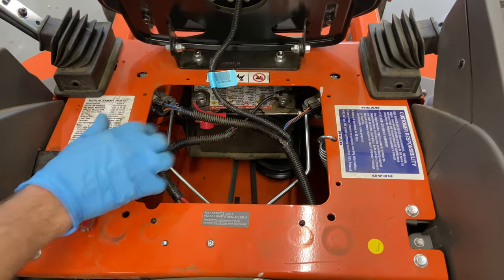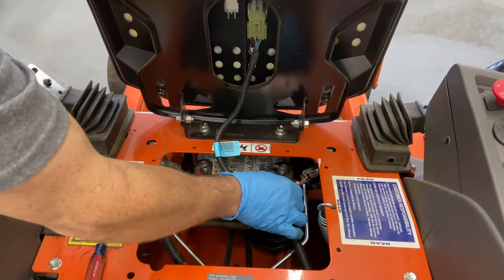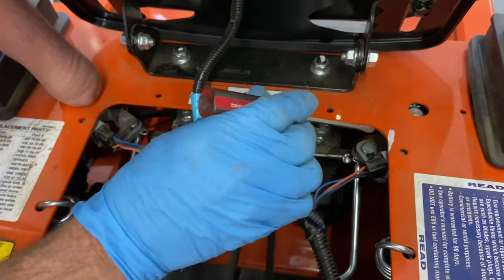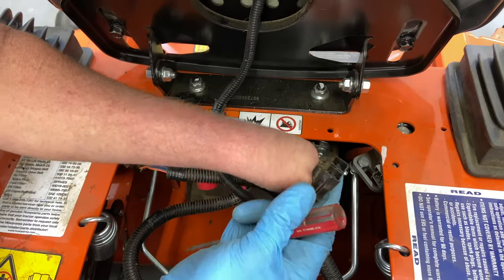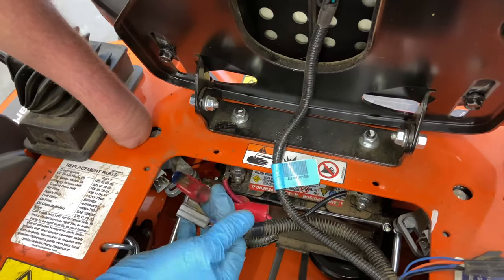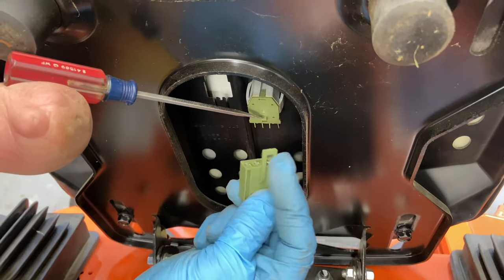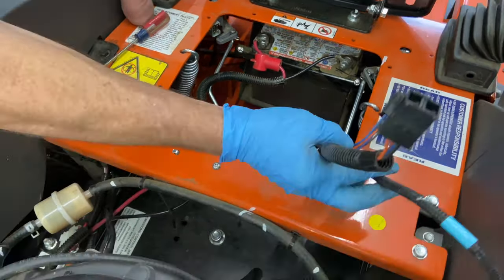Here's the battery — it looks like a mess with these wires. To make it easier, I'm going to remove the seat switch wire and also remove these two wires. You can't just pull them because they're clipped in with little tabs. Put your screwdriver in on that clip, pull it out a little bit away from it, and then pull the plug. These will sit off to the side, so when you lay the wiring back in, everything should just line up again. This tab right here breaks real easy, so be very careful.